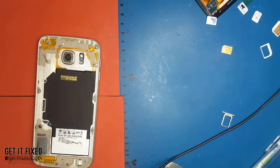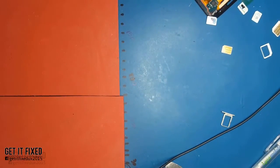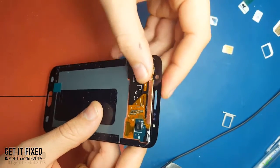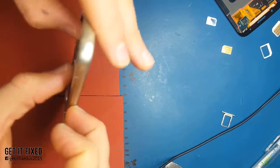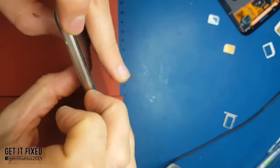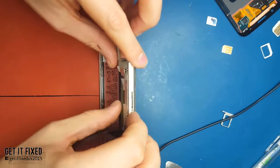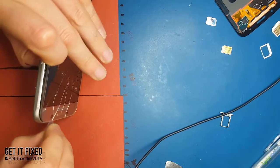It's like 16 screws to remove the bezel. A very important thing: after you remove the screws, if you want to reuse the LCD - say you just want to change the board - make sure you heat the front LCD for about 20 seconds at 100 degrees. What you want to do is separate the bezel from the mid-frame which supports the LCD. If you don't do this, the paint from the actual front glass will come off.